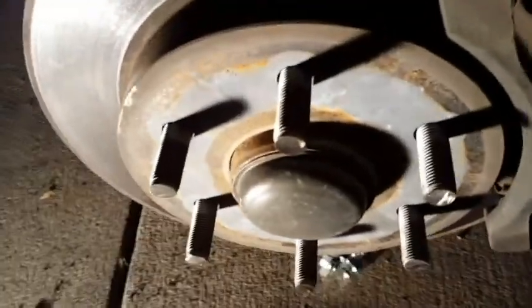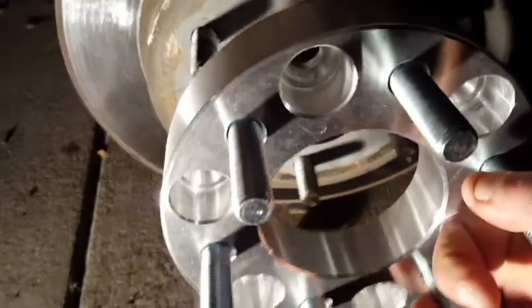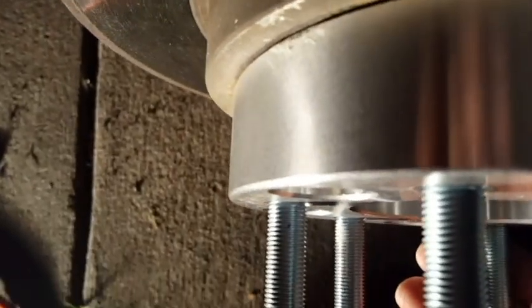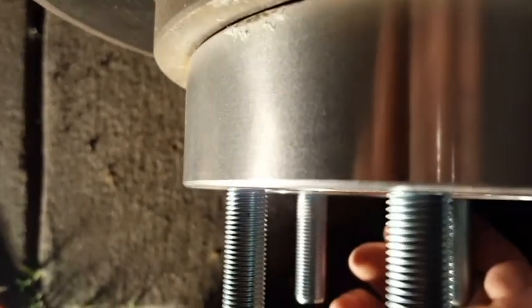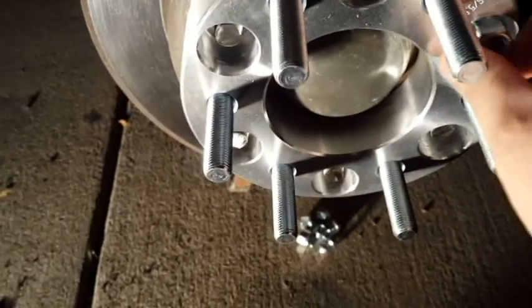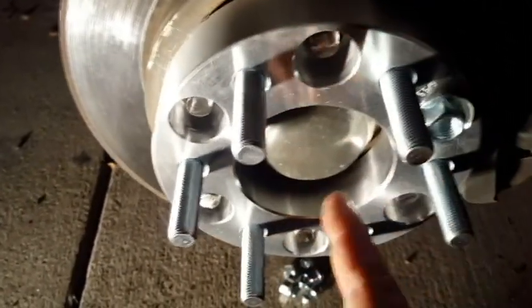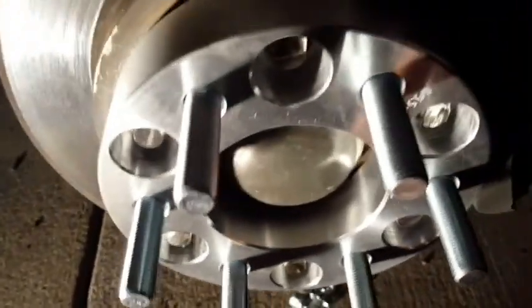I just got done cutting the tips of those studs. We're going to go try to fit our spacer — the whole area is clear now so the rim will be able to sit on here nice and flush. All we have to do now is use our lug nuts and tighten them up. Remember to always go across, never go side by side — always go opposites in the shape of a star so you get the right torque.